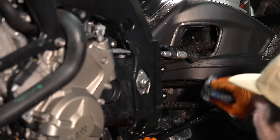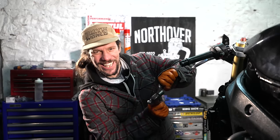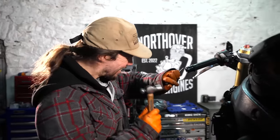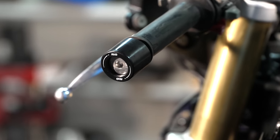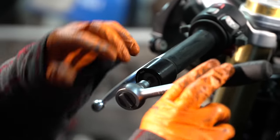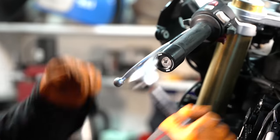Years of caked-on grime — that's better, a bit cleaner. I am chiselling tarmac out of the end of a handlebar — I must have corked a hole in the road. Technically there's no point putting new handlebar weights on yet because there's a million other things to do, but I've got some shiny stuff and I want to cheer myself up from all the hours of cleaning. These bar end sliders are pretty hefty but good for a crash, and they're weighted to be similar to the originals — because the weight of your bar end weights has a big effect on how much vibration you get up the handlebars.